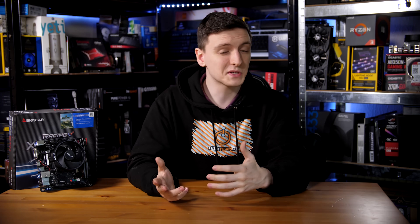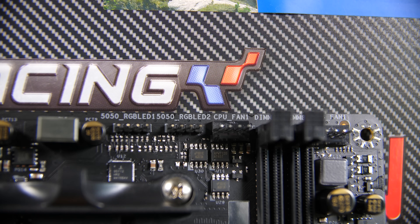With all that out of the way, I'm actually really impressed with this board. Is it the ultimate ITX AM4 motherboard? I'm not entirely sure. For long-term usability I might personally prefer the Gigabyte board — it has a better audio codec, a slightly better IO layout with a couple more USB ports, and an Intel NIC, which I generally recommend over Realtek for longevity, reliability, and Linux support. The dual RGB headers are nice but I'd rather have an extra 4-pin fan header instead.